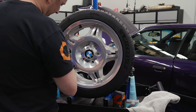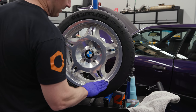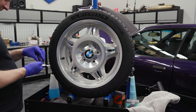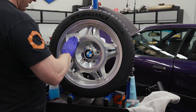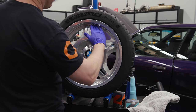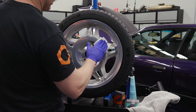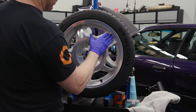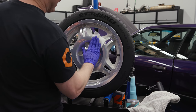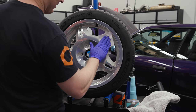This is about a one-minute flash time. It's really hard to see what's going on because these are gloss silver wheels. What I'm doing is timing it: I do the face of the wheel, wipe it off, then do the barrel of the wheel, then wipe off. That's worked pretty well — I've already done the passenger side set. But this is a lot tackier and gummier. It doesn't dry slick.